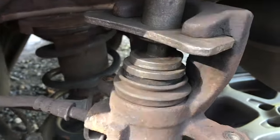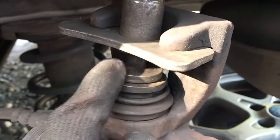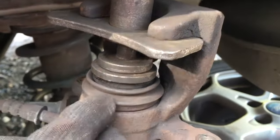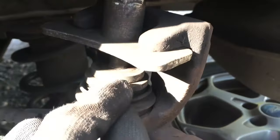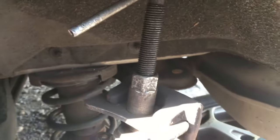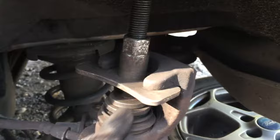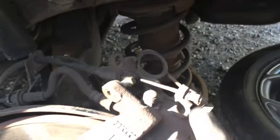The difficulties are not necessarily caused by a faulty caliper - they are mostly caused by a faulty handbrake cable which is sticking. So the first thing you should do when you find yourself unable to wind down the caliper is check if the brake cable is moving.